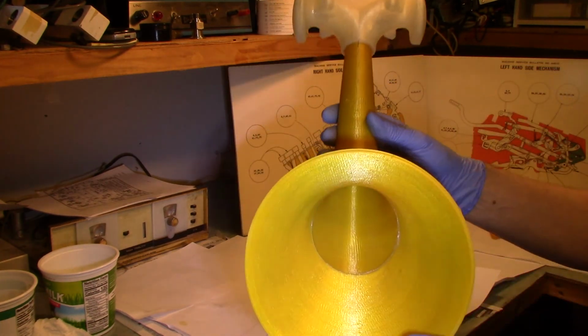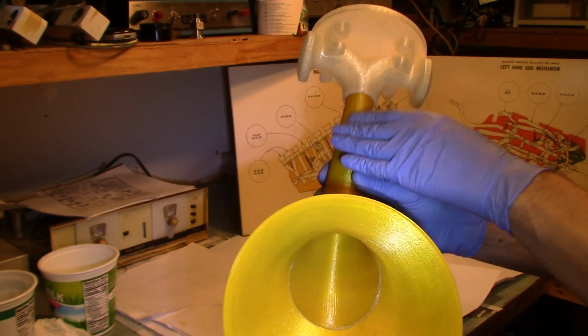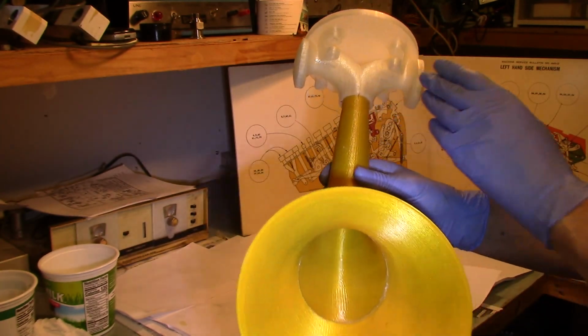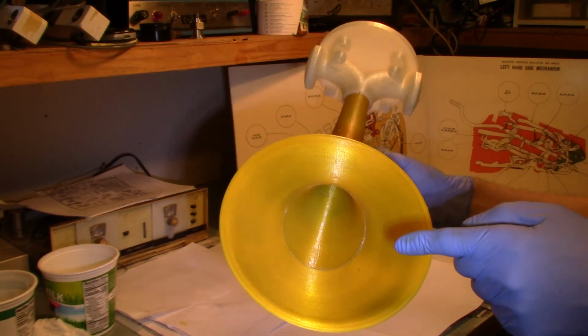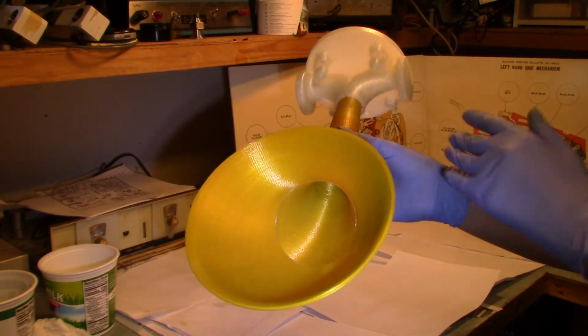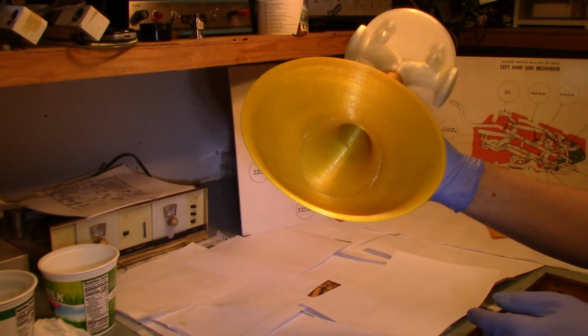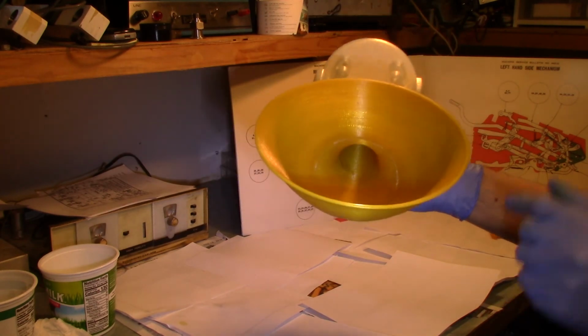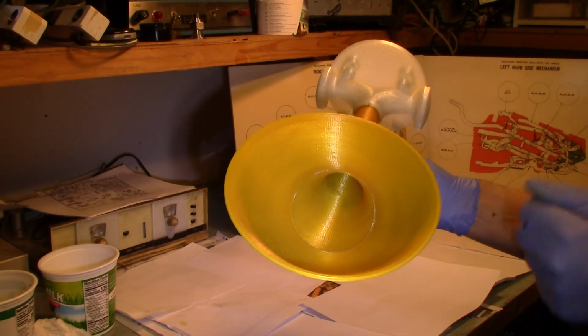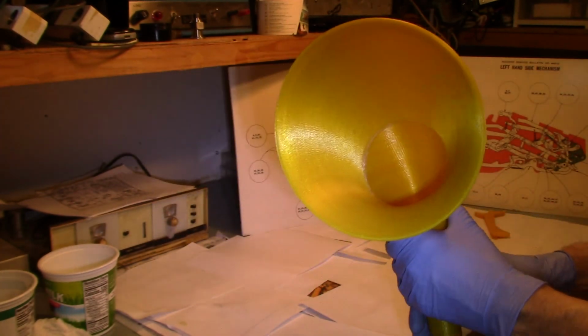Another thing is, it dawned on me that I had some little fibers inside this thing, and possibly up in here too. And so I've very carefully used a heat gun for a few seconds, blowing it down up in here, and I've melted off those little stringy fibers that, once I go to put any epoxy and paint in there, obviously it would cling to and really cause some restrictions.